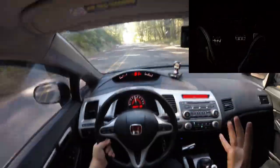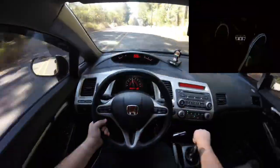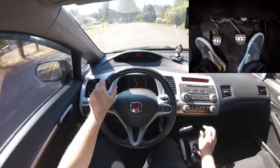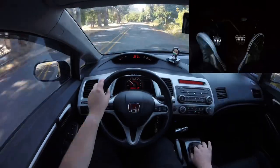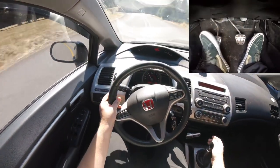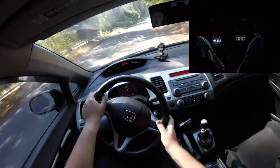The bigger the gear ratio gap, the farther the RPMs are going to travel between gears. That's why going from fifth to sixth the RPM barely drops — as we can see right there, it does not go down very far. We're going to be in sixth here at 2,000 RPM. I just blip the throttle — that wasn't even enough gas, it had to crawl up a little bit. But there — rev it, boom, perfect. You can even do it at higher RPMs.